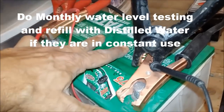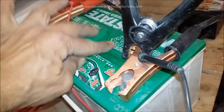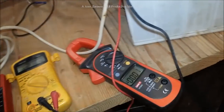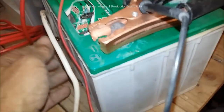Make sure the water doesn't drop the whole time you're using these, because that's how they get cooked, that's how RV fires happen, and that's how you'll see melted tops or posts on batteries — from that constant 8-amp charge that never goes away. If you have a 45-amp converter, you've probably got 20 amps going into two or three batteries and you will eat a battery. This unit is going to put a load on the battery — let me pause and get that hooked up.